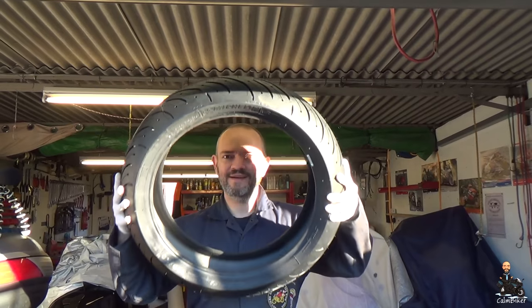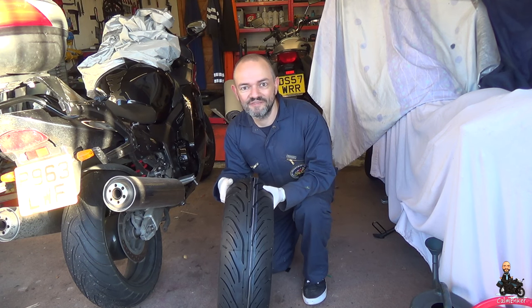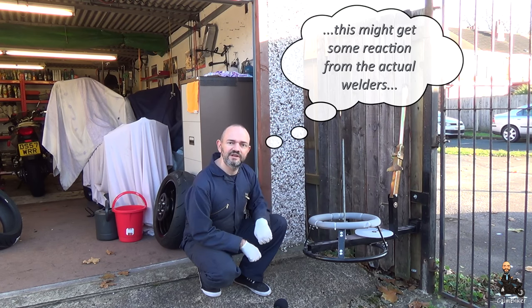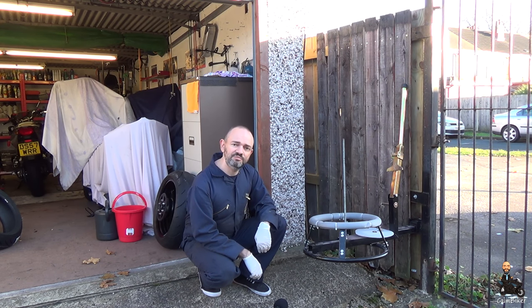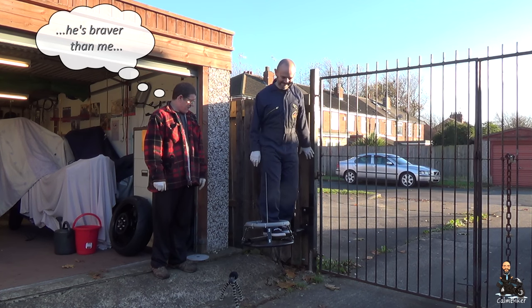Good afternoon everybody, Cam Bike here and I'm at Tosh Boy's garage to do a little job for the Z1000SX — tires. I've got a pair of brand new Pilot Road 4s to go on there, nice and big and fat. Next bit of kit we need is the tire changer. We've made a couple of modifications with my amazing welding — we've added a bar and mounted it to this fence here, and it's absolutely solid so you can really push against it. We've got a bit of foam on it as well so you don't damage the wheels, and the whole thing's set up at a height so you can push with your thigh rather than just your hands.